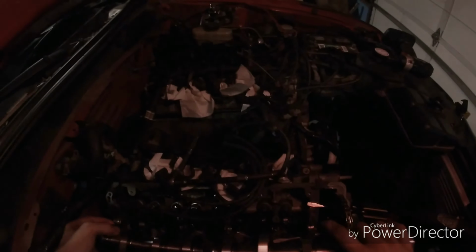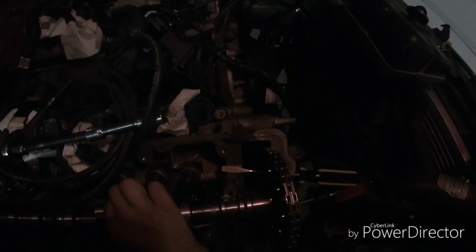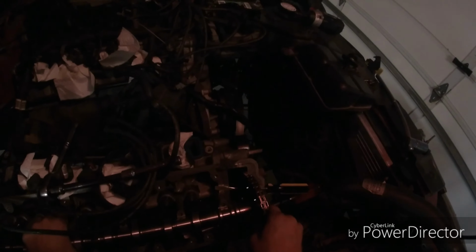So we're gonna go, and where's our keyway? Keyway's over here. So we look at where the keyway is on the original. What am I hitting? There we go. I like that. Down, down, down, down. As you can see, the keyway needs to come over. Gotta spin this this way. And the cam will sit right there, and cam gear will be able to slide up into cam.